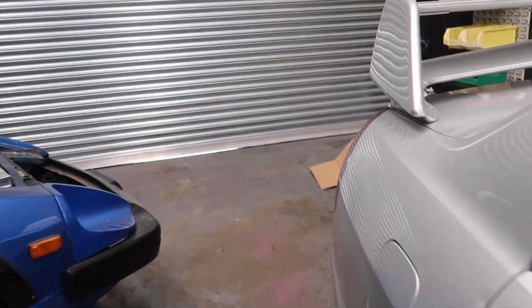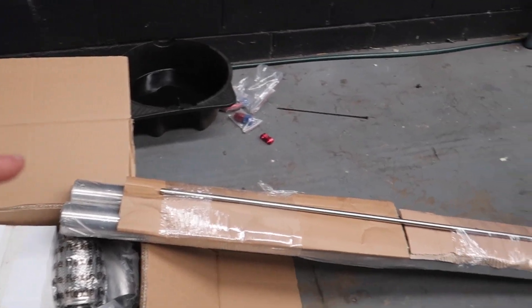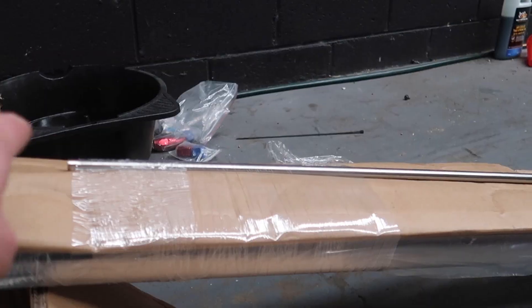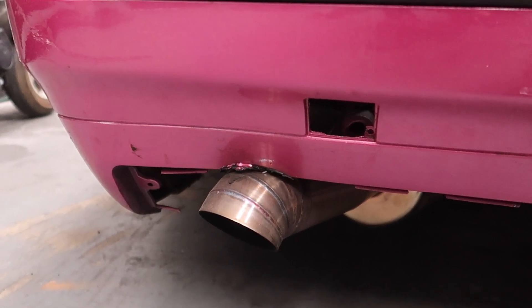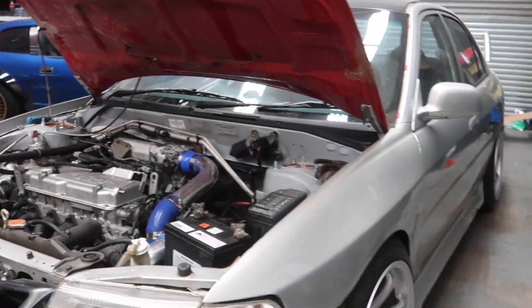Lots of parts are turning up for this build. First thing that's turned up is all of our exhaust stuff. Here we have everything we need to make our exhaust - we're doing a full two-and-a-half inch straight-through exhaust. We'll have a muffler, a flexi join, all of our 90-degree bends, and this rod here we use for the exhaust hangers. We're going to be making a full custom exhaust. Elijah at Springy Performance is making a lobster dump tip for us because I don't have the skills to do that myself.